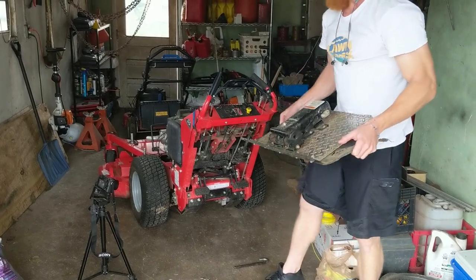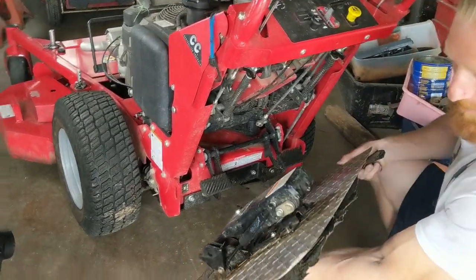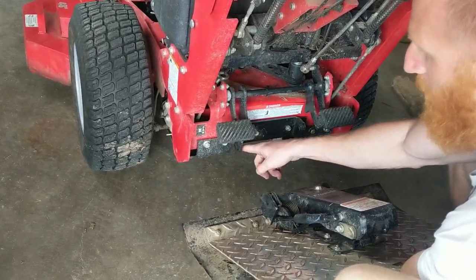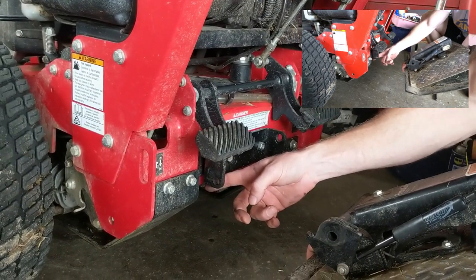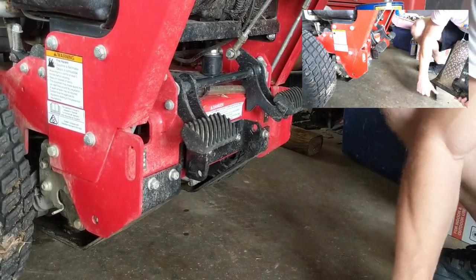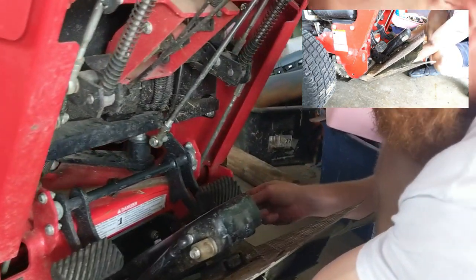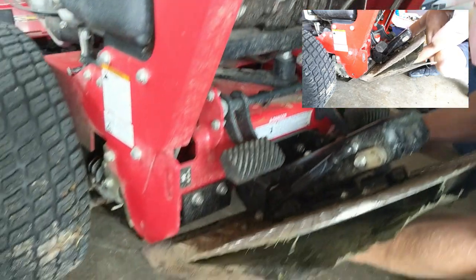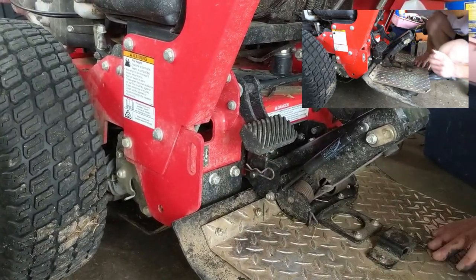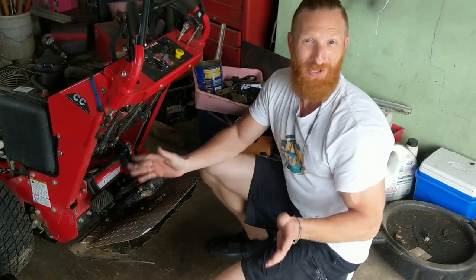So to install the ProSlide, we're gonna do it in reverse order. So I'm just gonna get back in position here. I have my arm under the unit. I'm gonna line this notch up with the bottom left-hand side of my mount. So bottom left-hand side of the mount, this butts right up against it, and then I'll slide my pin through. So here we go. I got it in there. Put the pin in one side, through the other side. Voila, there we go. Cotter pin, and we're secured back on the unit. So I hope that clears up how to install the ProSlide,